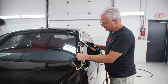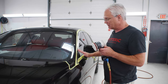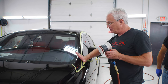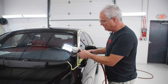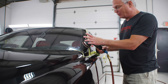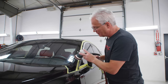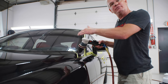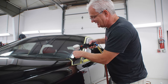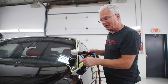If I look at this surface, from here to here, I have almost a flat surface. And then over on this side, I've got another surface that's like flat. So what I do is I'll treat these as two completely separate surfaces. I have to remain flat up here and I have to remain flat right here. With the pad, I want to keep it flat going in this area, and down here I want it flat going in this area so I get full coverage. But on this edge it drops off, so as you're doing this — and it could be even just a regular rounded A-pillar — I want to make sure and rotate my pad over a bit so that I make sure I'm getting that last little bit of the edge. If I just keep it flat, there'll be a little bit left over in the edge that I'm not going to get.